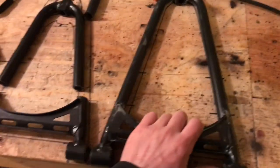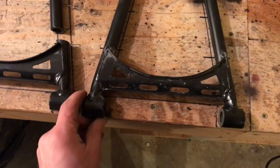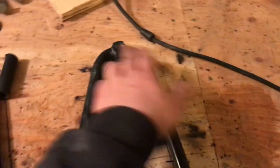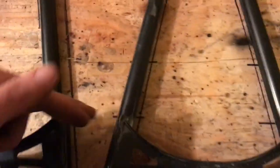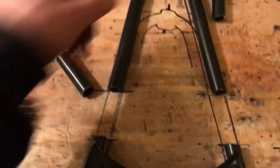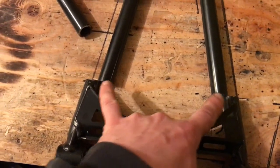We're doing upper arms first, doing them one at a time — laying them out on a table, marking which one is which. This is the right one, this is the left one. We want this to be square here, and I happen to know there is an 11-degree offset, so we mark that down. Then I figured out where I wanted to take the two and a half inches from — right there — made those marks, and cut it out. So now there's two and a half inches missing, which is going to bring it down to the target length. But you can see the issue: this no longer lines up, so we have to make this wider.